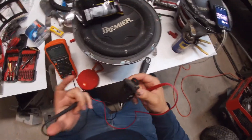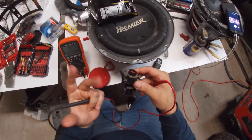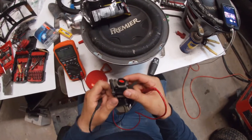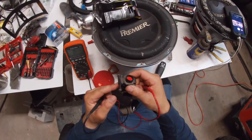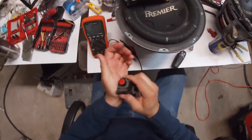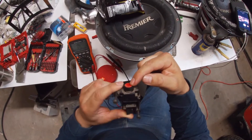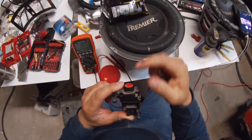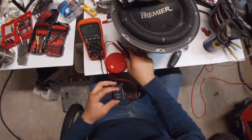The way this works is: in a collision, the switch opens — the contacts inside open — so it shuts your fuel pump off. Let's try that again. I'll hit this switch. There you go — you can see the red button has released up, so I'll check it again.